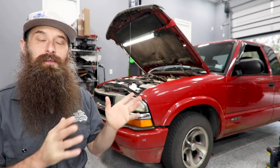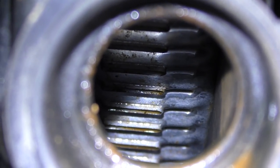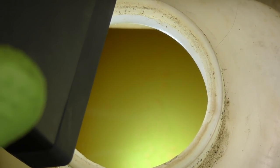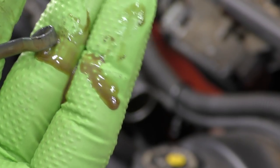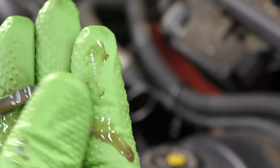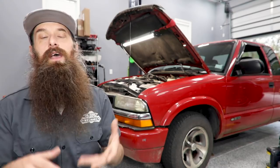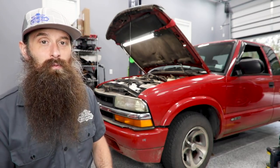This truck belongs to a super good friend of the family, and they're having some overheating issues, so I figured I would try and help them out. There is a little bit of a backstory to this car. They were having some coolant leak and some overheating issues, took it to a local shop. The shop diagnosed it as a bad engine — that's an awful deep way to go right off the bat. There was also a leaking radiator, and I think the thermostat was sticking. So rather than just going all in on the engine, they put a radiator in it, they put a thermostat in it, and now the car is still overheating. So what we're going to do today is walk through what's going on. I'm basically convinced that it's a leaking head gasket, but rather than rolling those diagnostic dice, we're going to do some more testing and make sure we're at least in that ballpark.